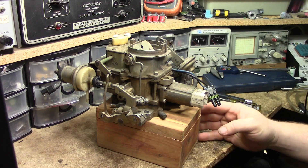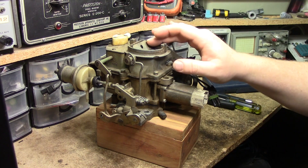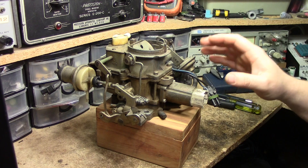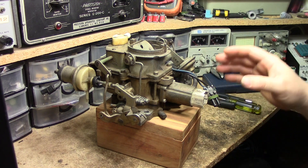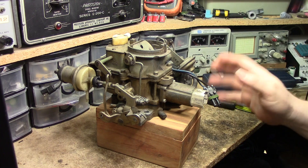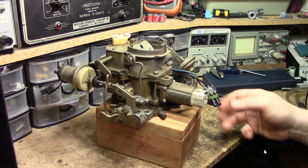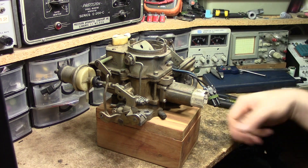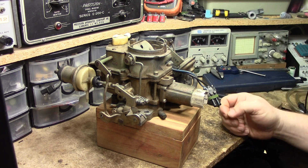Once it warms up, no problem. That typically falls down to misadjustment of the choke plate. There is an initial choke setting that the vehicle tries to sustain before the electric automatic choke takes over. Most people get so fed up with this that they just remove the electric choke completely in favor of putting a manual choke in.